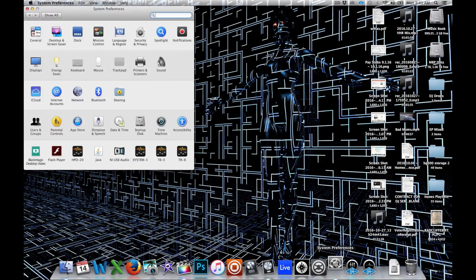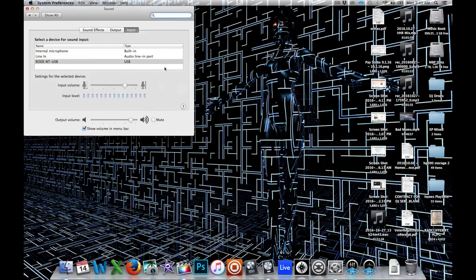All right everybody, here I am — Chana D, your Technodad. I'm talking to you via the Rode NT-USB. I've got that hooked up pretty much just through USB. There's a USB port on the bottom of the microphone, which I'll show you at the end of this video. That's plugged into my laptop USB port. What you have to do is go into System Preferences, then go to Sound. On the tabs at the top, you get Sound Effects, Output, and Input — click on that Input. Then you'll see the Rode NT-USB microphone. It's actually an audio interface is what it is.